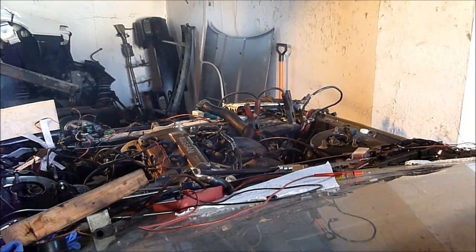I was on a whole bunch of forums — Zilvia, any 240SX forum I could find — trying to figure out why there was no spark, and I figured it out. F1 plug — the ground wire on the F1 plug — solder it, don't tape it. Suck it up and solder it the first time, make the wire long and ground it right to the engine. Mine is grounded right to the same ground the injector ground uses. I don't want to guarantee it'll fix everyone's issue, but it fixed mine — no spark, grounded to the engine block, and it started.